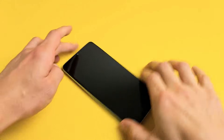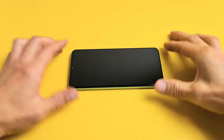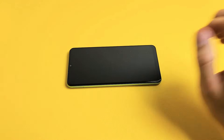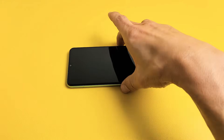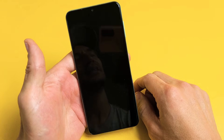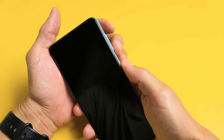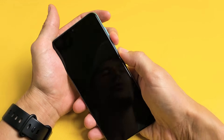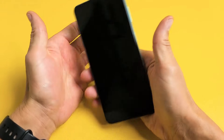The next possible solution is what I call the freezer method. Put the phone — nice and naked, without a case — into your freezer. Leave it there for 15 to 20 minutes. After 15 or 20 minutes, grab your cold freezing phone out of the freezer and see if you are now out of the boot loop. If still stuck, while the phone is nice and cold, force it to restart: volume down, power button, press and hold both until the Samsung logo appears, then let go.